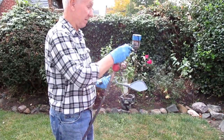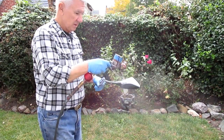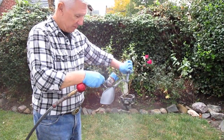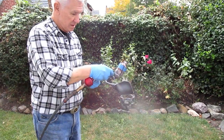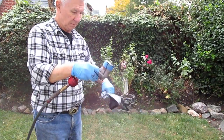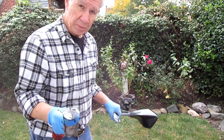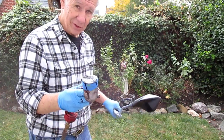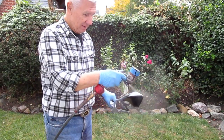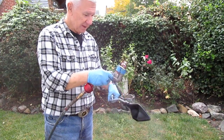It sure has the look that rain is coming very soon — not later, sooner. So I'm not sure how much of this we're going to get painted today, but we'll work right up until it rains, that's for sure. Another thing: anytime you're doing plastic parts, it's a good idea not to put any more thinner in the paint than you have to. Like 60 paint, 40 thinner is a good place to start, because it's that thinner that can get in and turn plastic into alligators.